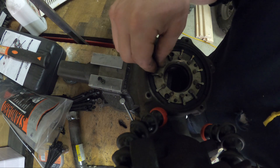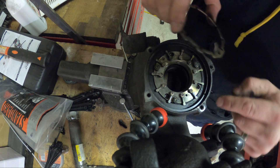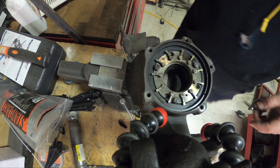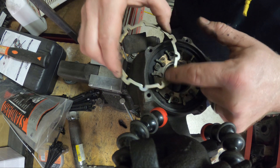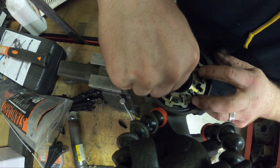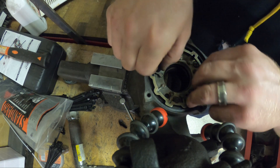What I've found is the easiest is put these on the posts first, and then you can raise them up as you get the ring into place — it'll kind of hold the ring above these. Remember our dot — where's our actuator? Oh, it's on the other half, you stupid. Anyway, that dot lines up with this guy right here — the locating pad lines up with the tooth that moves it — so you want it kind of like that. Then you can pick up a ring and it'll pop into place.